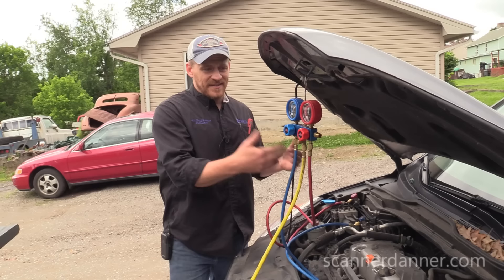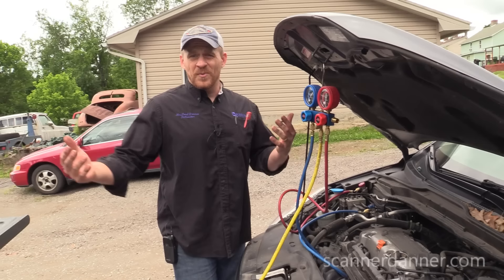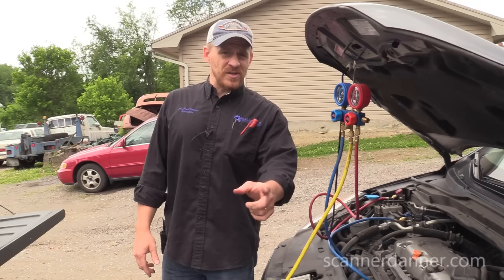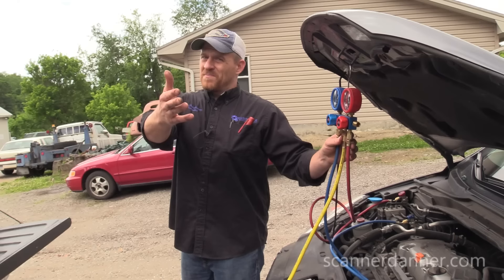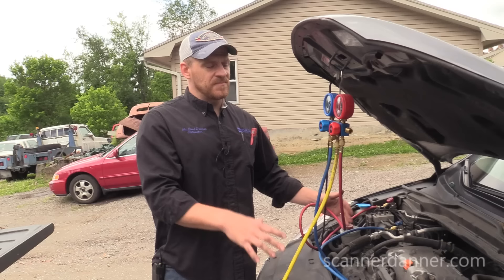What we're going to do next is air charge it and check for leaks using soap and water. I've shown this method before in my deep repair videos — I'll put links in the description. I do not have nitrogen; I agree nitrogen would be ideal. But my argument for using compressed air is: what do you think is in this system right now? It's completely empty of pressure — there is atmospheric air in this system. I'm using compressed air, and I'm not going to cause any more damage than what's already here.